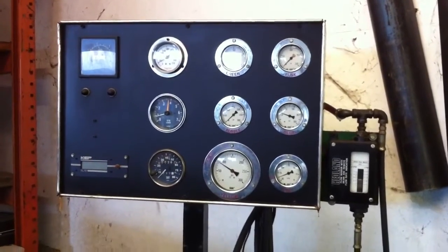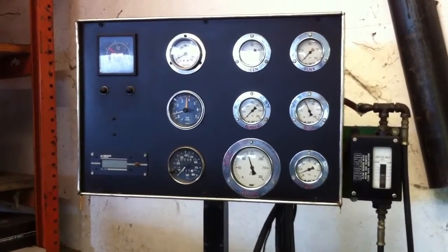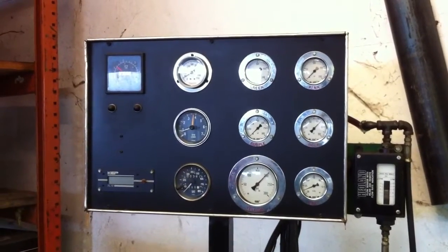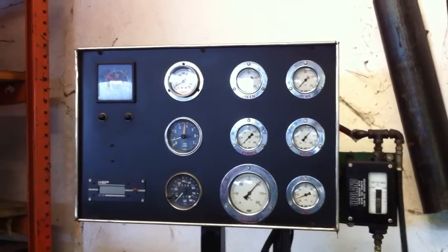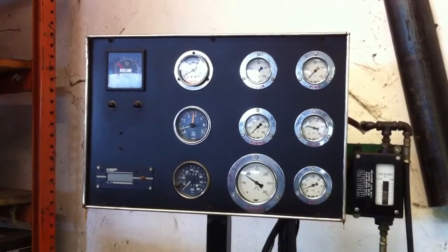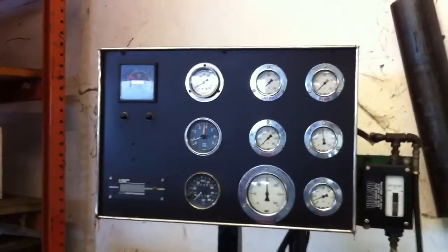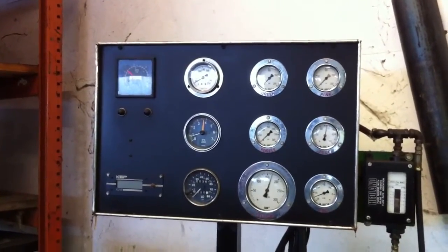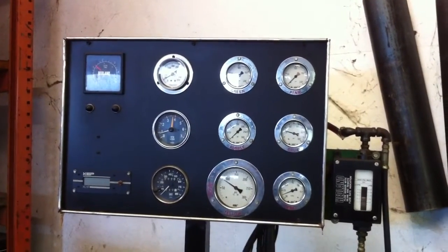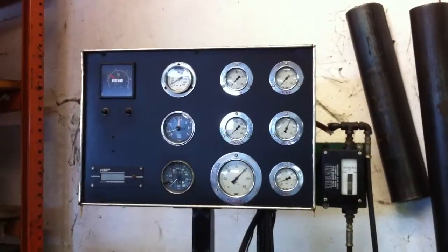Here's drive position - 85 psi. Pulling throttle: 110, 120, 140, 150, 160, 180, 200. That's 200 in the overdrive position on max throttle. Backing that out a little bit, you can see how nice the needle flows. With the transmission in the van my pressure was 150, and then after that it only went up to like 170-180. I never got the max throttle that I needed. That was in the overdrive range. That's third gear, same thing - 85 base, max 200.